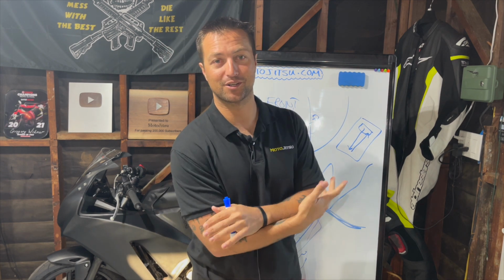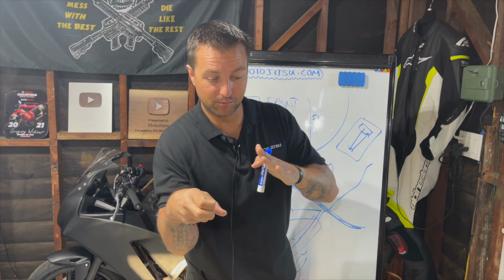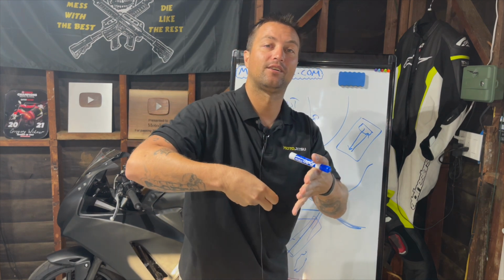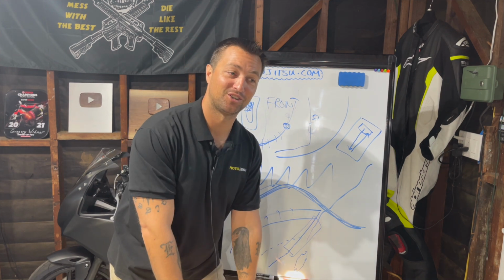If you grab, you're probably going to crash, almost guaranteed. But if you squeeze the brakes, as you squeeze, the bike slows down. As you take away lean angle, the bike has more traction because it's more upright, and you can squeeze on the brakes and get harder. There's a whole other level going into that. So that's 5 levels for this in a straight line. Now let's do everything in the middle of the turn.